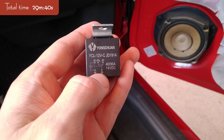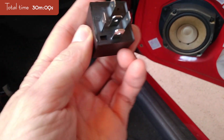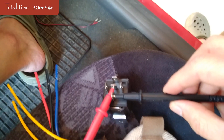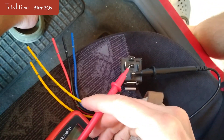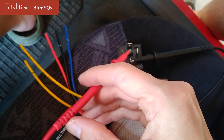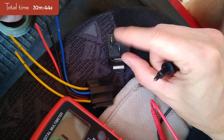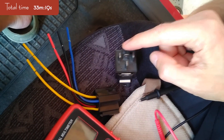To make sure this actually does what it says: if I connect the multimeter to pin 87A — the middle one — and pin 30, the bottom one, we should hear a beep. If I connect to pin 30 and pin 87A, we have the connection, we have the beeping. So by default, because we have no electricity, this connection is opened, so this will go to the ground. Pin 87A is the middle one, and pin 87 will be the positive.